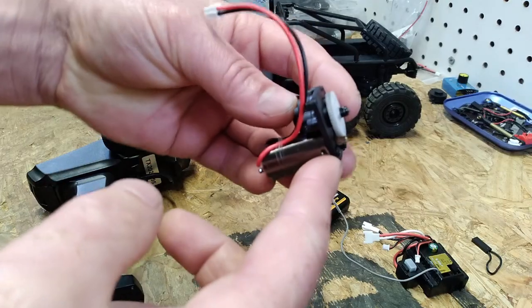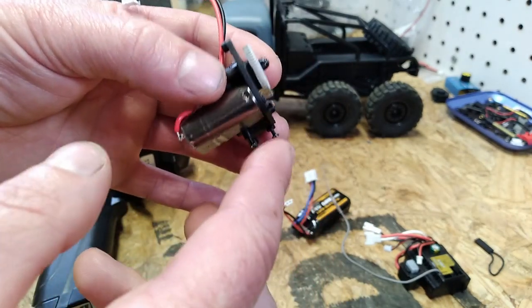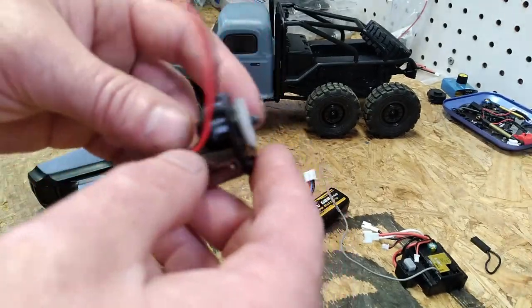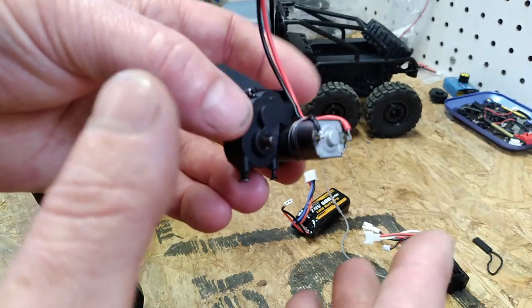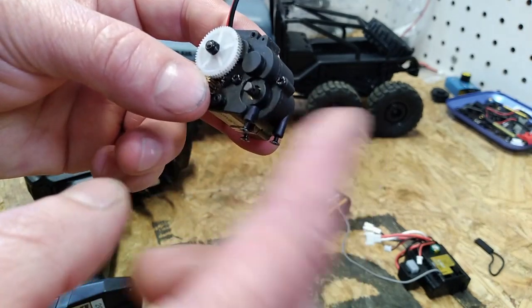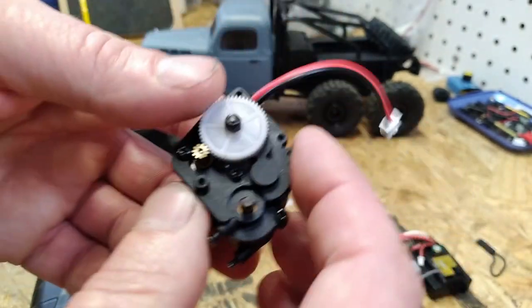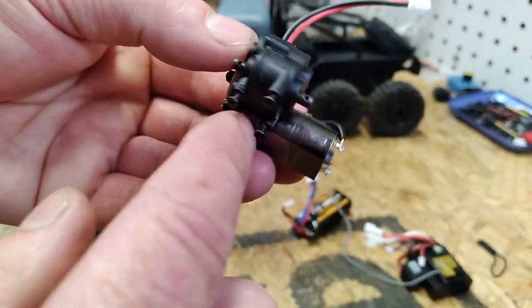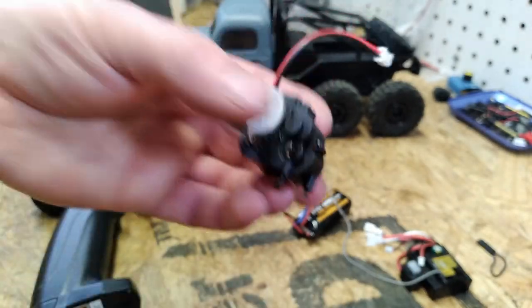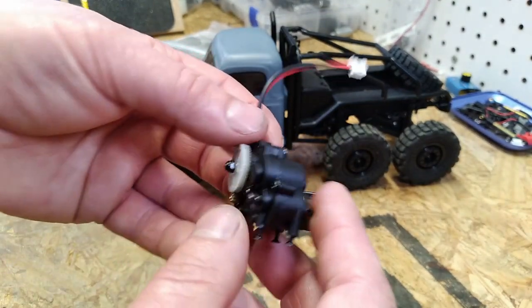After replacing the ESC, the little MoFo Torque Beast was doing really well and it wasn't getting over about 85 degrees. After replacing the motor and putting a substitute ESC in there I was pretty happy with how the vehicle was running — the MoFo Torque Beast 50 was doing a great job pushing the vehicle around. But after probably about five minutes of enjoyable running, the torque from this motor completely shredded the plastic gears inside the gearbox. The main gear that drives the output stripped about three teeth off it and the gearbox was no longer functional.